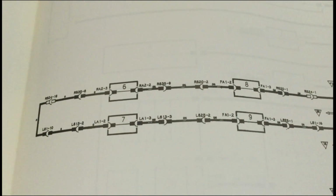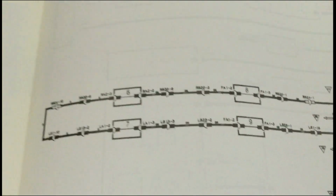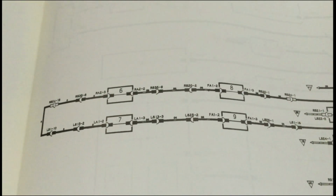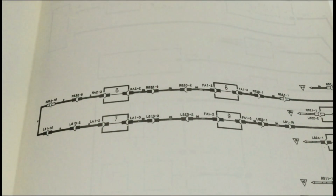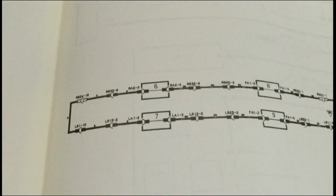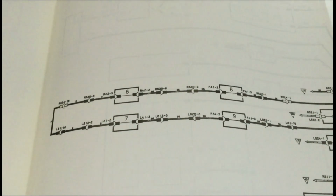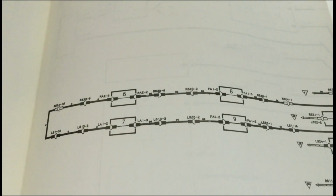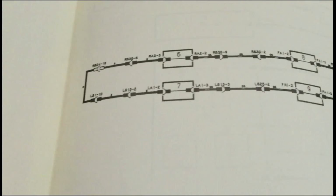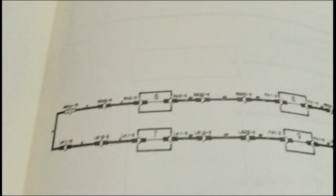Something else that would need to be sorted out is, for example, if you had the headlamp levelling switch within the car, which activates motors on the headlamps to level them out depending on how much load you've got. That is something else that now needs to be resolved if it's not working, even if the headlights are at a correct angle and can be adjusted for beam, etc. The actual switch and those motors need to function. So if you have one of those, it's worth parking in front of a garage door or a wall when it's dark and activating the switch, making sure that the headlamps go up and down. Also, if you have the low brake pad warning illuminated, it's worth investigating why that's on, if it isn't just the pads. If the pads are low, then you have to replace those. But if they're not low, then you'll need to get that sorted out.